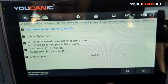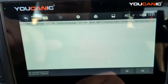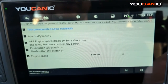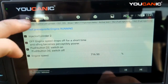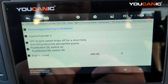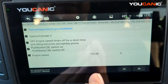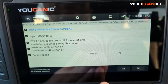Write that down, then turn the injector back on by pressing three and give it about 10 seconds to let the engine stabilize. Then go to cylinder two, note the idle RPM, and turn it off. You notice the engine shaking again. Compare the impact of cylinder one with cylinder two and the RPM drops you're seeing. Those two — when turned off — should both have the same impact.